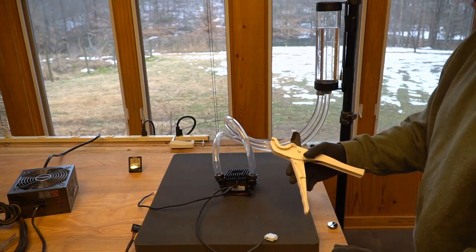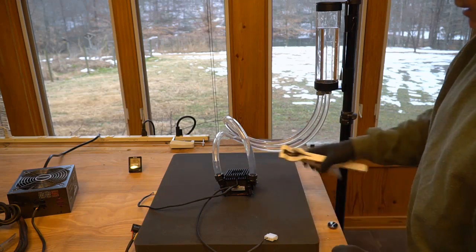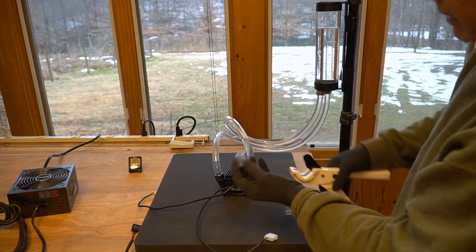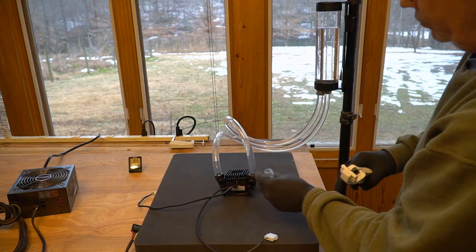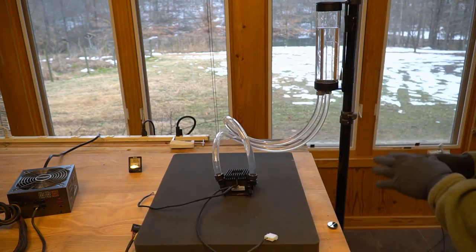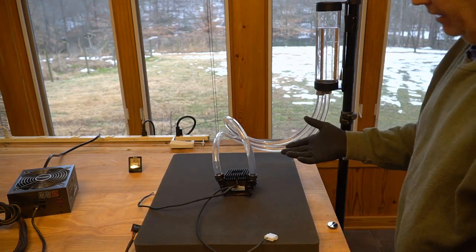tubing cutter. And the tubing cutter is set up so that if you want to, once you get the water out of these lines, you just snip the line and get it out of your way, you can. And this works real easy. You just put it in there, clip it. It gives you a perfectly straight, smooth edge. That way when you're putting your new line on, it lines up perfectly. So there's that. So when you connect your new pump, a couple of key points.